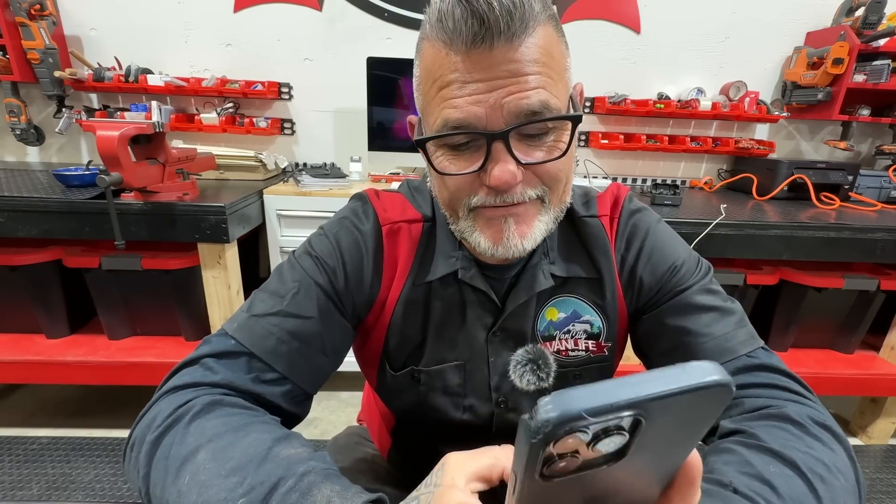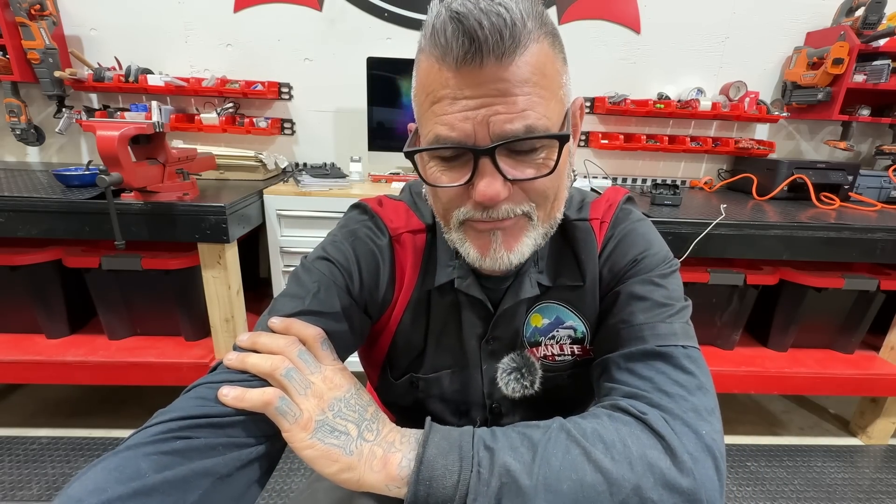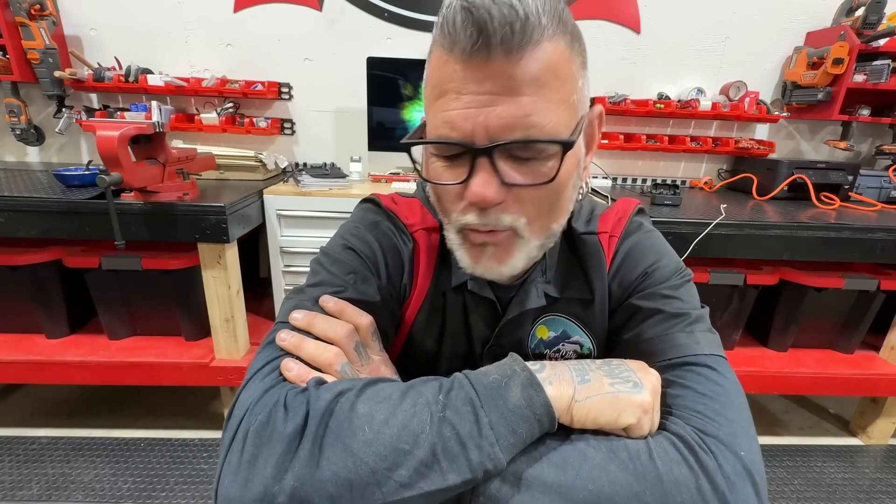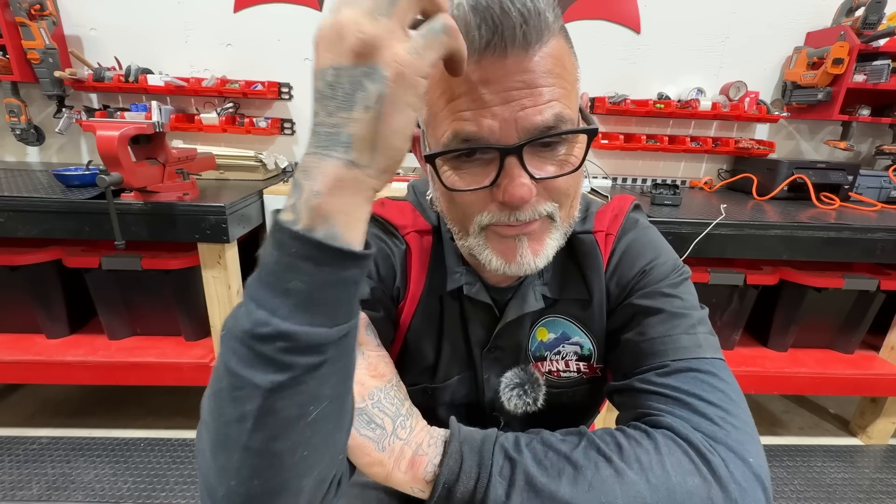I have a lighter — I could go out in the back bush and have a nice big van fire. I just went online and watched the video of my rust repair in the backcountry and took a look at what we did on the passenger floor. We only welded a small little section on the passenger floor, and the rest of it we left alone. There was some rust on it, so we just put some rust converter on it and painted over it, put some body filler on some spots. That rust on the passenger floor should have fully been cut out — that whole floor should have been chopped out, just like the driver's floor back then. And the sad part is that floor has chewed up the body mount below the passenger foot, really really bad, to the point that I'm not sure if I could salvage and weld around it again.